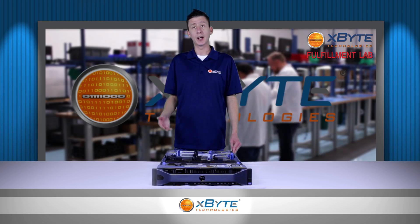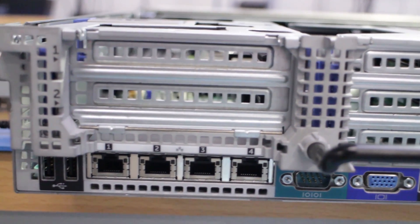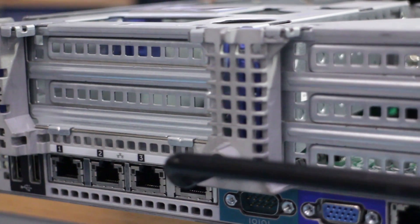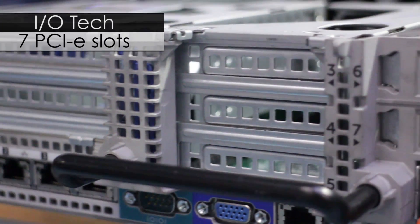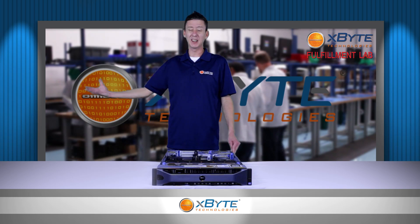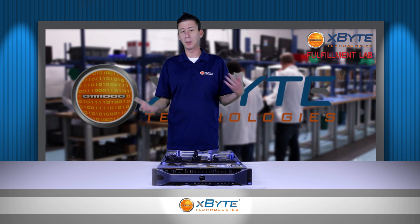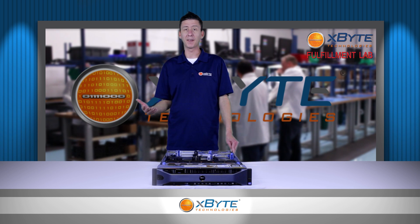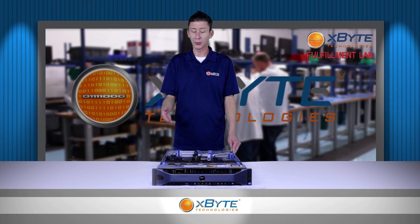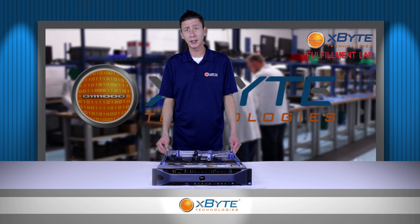With your I/O tech, it comes with onboard quad-port Ethernet in 1 or 10 gigabit flavors. You have up to seven PCIe slots — four full-height and three half-height — so if you're going to be bringing any legacy cards over from old servers, keep in mind what kind of slots you have and make sure they'll match your card. It also includes a dual SD card reader, which is great for your hypervisor needs.